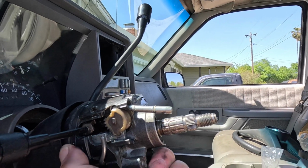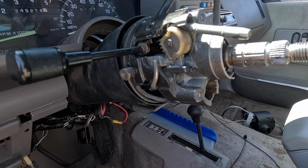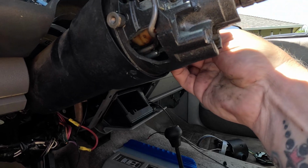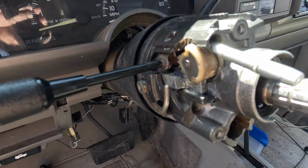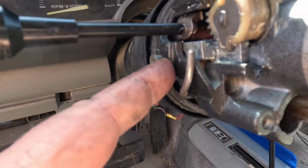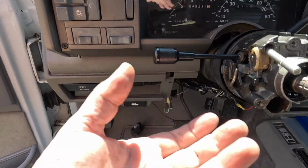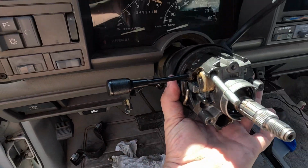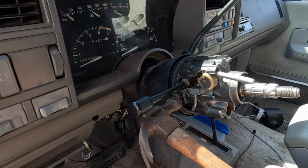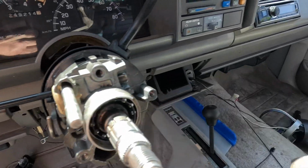which mine weren't lined up at first because I only had it on the first click of those jaws where I thought it was supposed to be, but now we know we can tap in these pins on both sides. Okay, so with some wiggling around, you can get these pins pushed in this far by hand. It's not until you reach that shoulder that it actually presses in. So just grab the handle, grab the whole unit while squeezing these in, wiggle it around, and get them popped in that far. Then they will tap in the rest of the way quite easily.